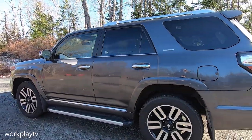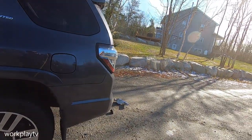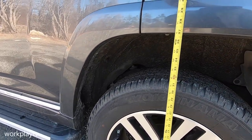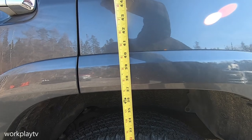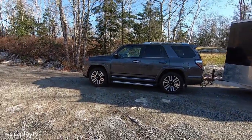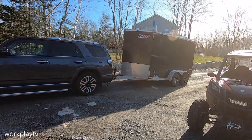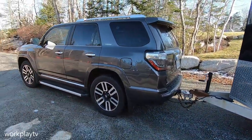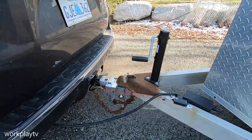I'm going to get the trailer hooked up. I'm also going to put my Can-Am Maverick inside to give us the weight I'm looking for. I'll take a measurement right now to see where we're sitting, and then take a measurement after it's loaded to see how much she dropped. Right now we are at 37 inches. Let's get it loaded up. We got the trailer hooked up and honestly it really didn't sag at all — it didn't really come off the block much, sitting there very nice right now.